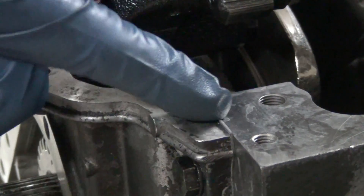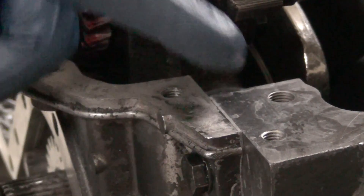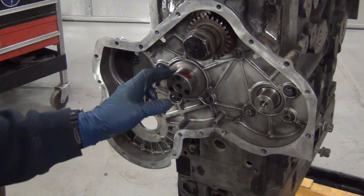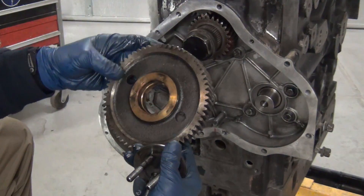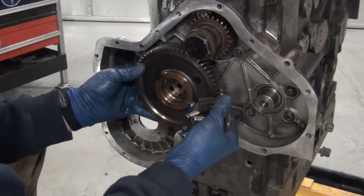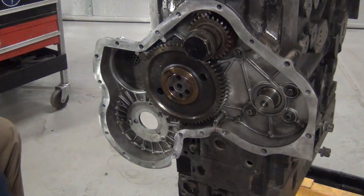One more little step — we've got this gasket sticking up right here, so we're going to trim that off. I'm going to take a little bit of assembly lube and put it on. On this side there should be a bunch of little lines — two here, one here, and one here. Thread that in with the crank; the oil comes through that and lubricates this thing.